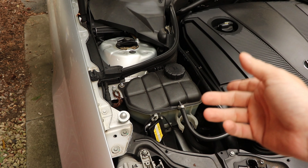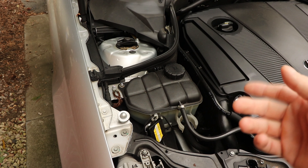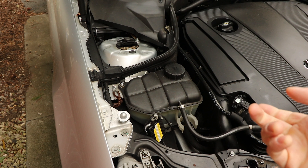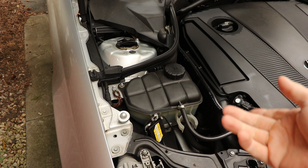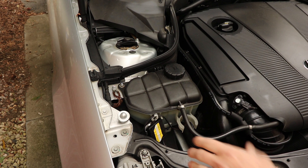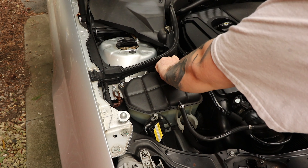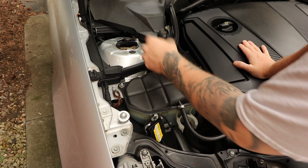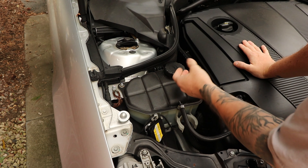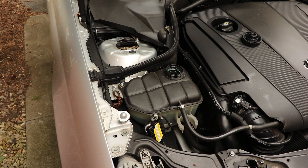If your coolant level is low you need to top it up, and if it's just a little bit low you're okay to just use water. There's debate about whether to use normal water or deionised water — deionised water has no mineral deposits dissolved in it, whereas tap water can cause limescale and mineral deposits. For most cars it's probably not an issue to use normal water, especially if you're maintaining a 50/50 or recommended ratio of water to coolant. Pure water without coolant won't cool as effectively and does risk those deposits.